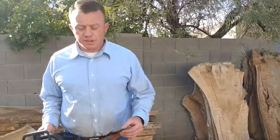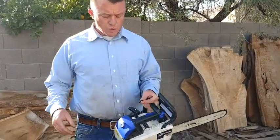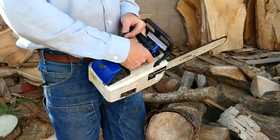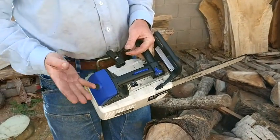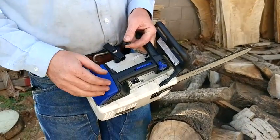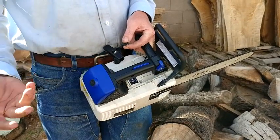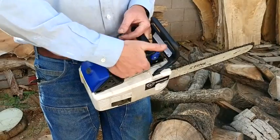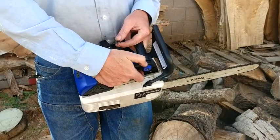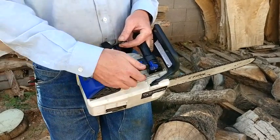So I figured out why it wasn't starting. First, on the choke, it really needs to be mashed hard, so it wasn't choking it all the way. It was a partial open, so it was just pulling air, wasn't pumping any fuel. So after some troubleshooting, didn't need to do anything mechanically to it, I think it's just that choke is breaking it in, just really mashing it down and putting it through.